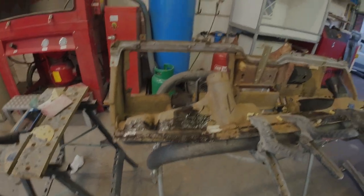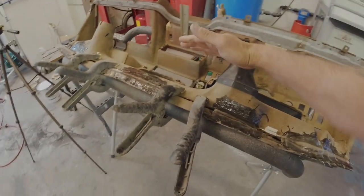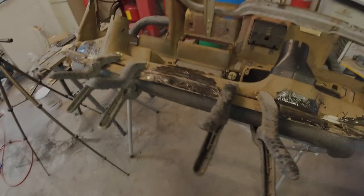So what I've decided to do is put these clamps on here now to pull that duct down towards the dash, and I've used some woven fiberglass simply because I can wet out that fiberglass away from the dash on a table. So as I offer it up to the dash, I'm not trying to work resin through it. It's already got the resin impregnated in it, so there's less chance of that resin running into the dash and coming out of the vents. And it's also quite neat, takes up no space at all.